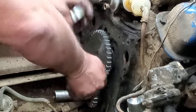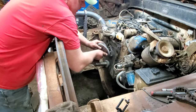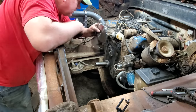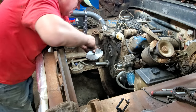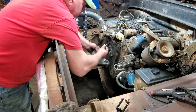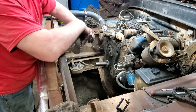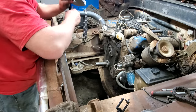Huh. Well, the issue is this pin is pressed in the old gear. Well, this in here, it just slips back and forth. So you would think the manufacturer of this sprocket would know that. They'd give you a longer pin. No, sir. So I've either got to make a longer pin, or I can shove something in this hole here that is the thickness of this so it'll stick out. So I'll get back to you when I figure out what I'm going to do.